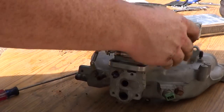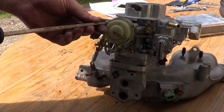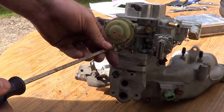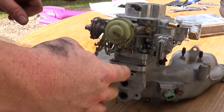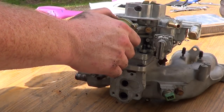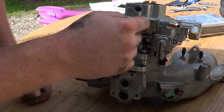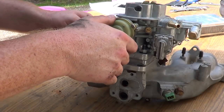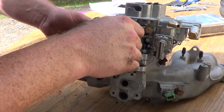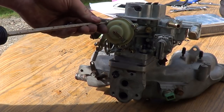If for some reason you're having problems with it idling high even after it's warmed up, you want to adjust this. You loosen three of these, then loosen this and turn it out of the way — see how that comes open. That adjusts the cold idle, so you'll have to readjust that once you move this, and adjust the warm idle too if you didn't get that right. You're basically adjusting so it won't hit the cam — or it will — until you adjust that. It's a little hard to explain unless I'm standing right next to you.